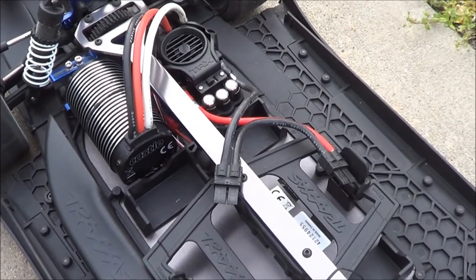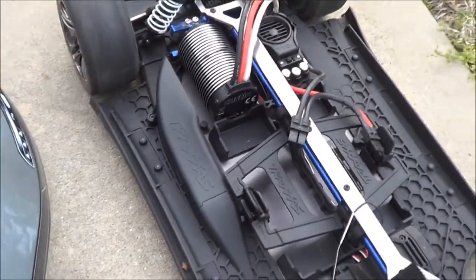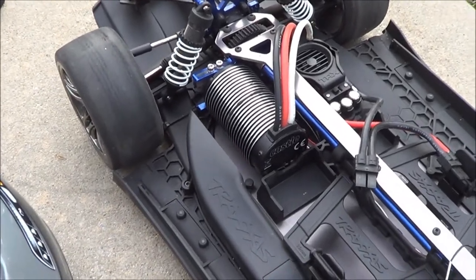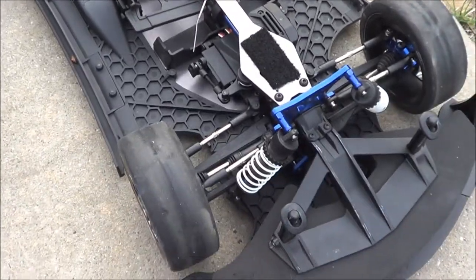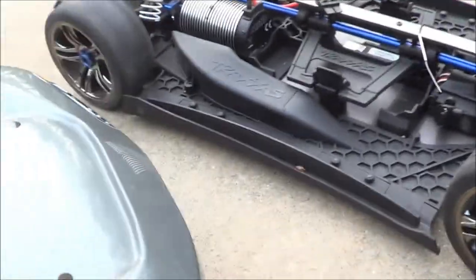If you do 100 and drive around, you're going to overheat the motor. So I figured the 23 tooth pinion, smack in the middle, still does 80 miles an hour, and I was happy with that. It's perfect to drive around, you don't get any overheat problems. It's just a perfect setup, I think. And I'll still throw in the 100 mile an hour pinion that comes with it.